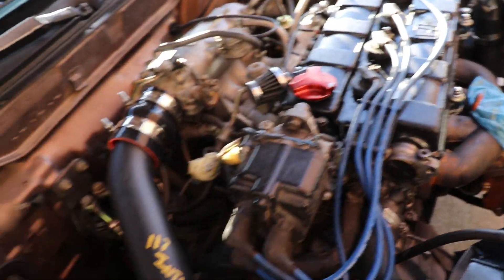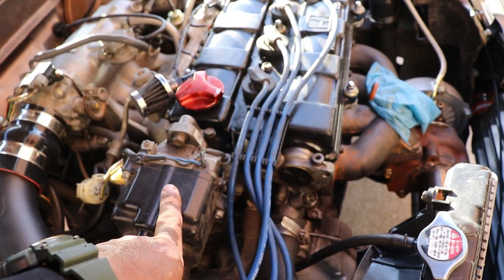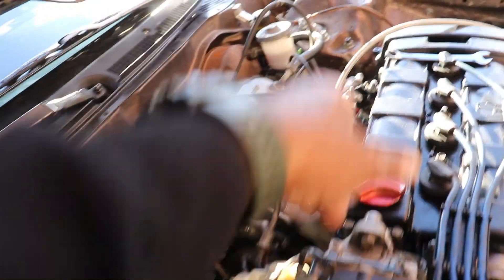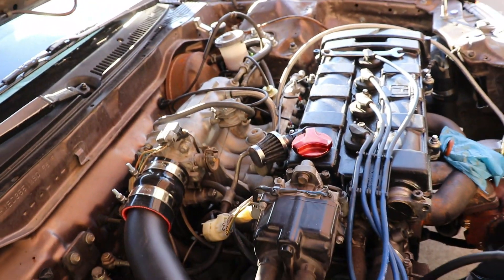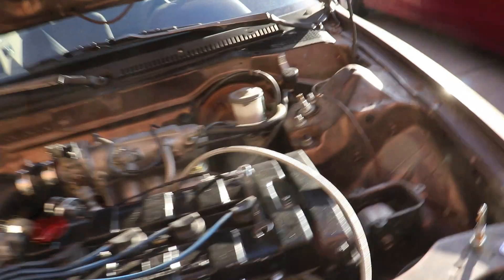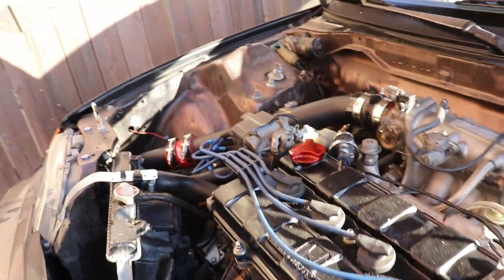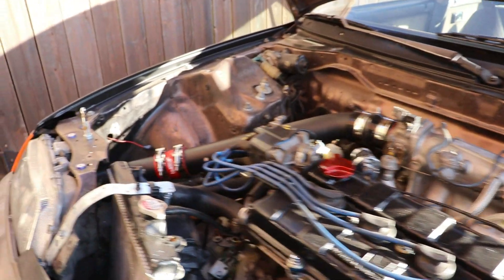I'm also switching this to OBD1, so I got to put the ECU in and put the OBD1 distributor in. Like I said, I still got to put my injectors in — I already made sure the injectors will fit with those plugs. I got the RC750cc injectors, that should be good for now. Then we'll have to take it to the dyno, or I'm thinking about doing a street tune because I kind of want to learn how to tune it myself. I already have a base map, so we'll figure that out as we go.